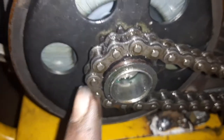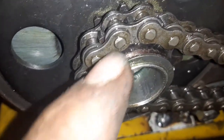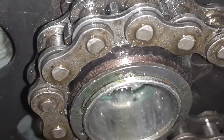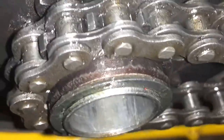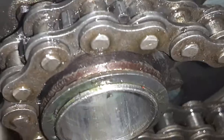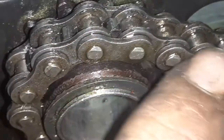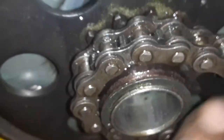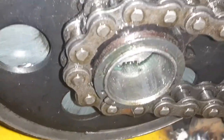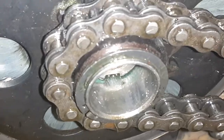You don't need to take your clutch apart every time to oil that bushing. All you gotta do is after you're done riding, take some motor oil and put it behind that bushing right there — you can see the gap. Put it in there and the oil will work its way around into that bushing. Do it every time you ride, otherwise it's going to dry out and your clutch is going to prematurely fail.